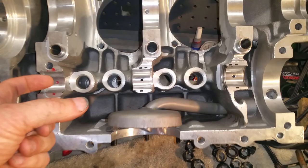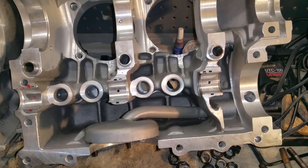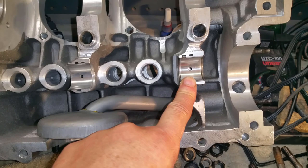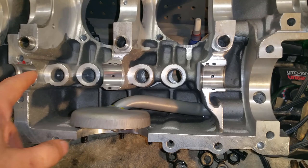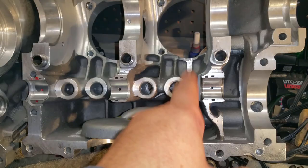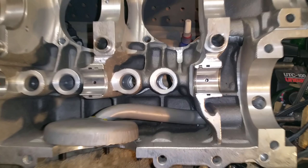We're back. Remember we drilled it like this and then down, so now this side of the bearing has oil pressure. These are the ones that were on the 2234 with the HVX oil mods. This is the mod I would recommend — everything else is choose your poison. The rocker mods, the tappet or lifter mods where you cut three grooves — those are all optional. I would definitely do this one.